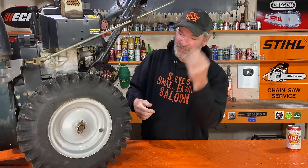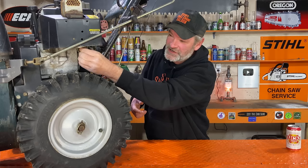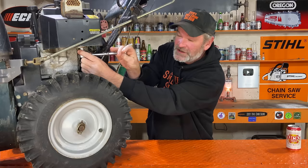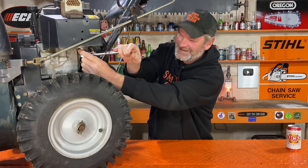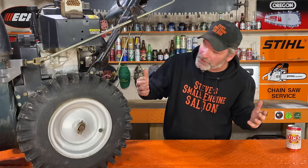Let's put that back in the bowl, holding the bowl back on. How easy was that? You don't need any mechanical experience to pull a bolt out and clean it, or a jet out and clean it. We are going to take this outside now and try it. I don't have the torque settings for this — the torque settings are called snug. There you go, click — that's snug right there. Hemostats, back off. Carburetor's filling back up with fuel, and we're taking this back outside to see if this actually worked.